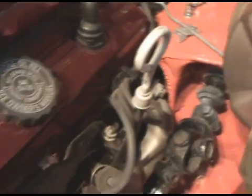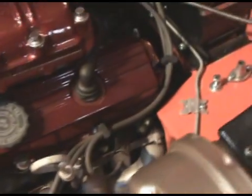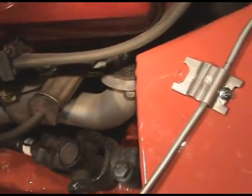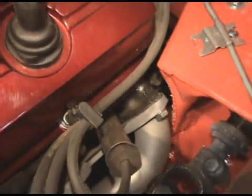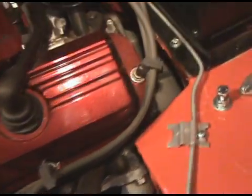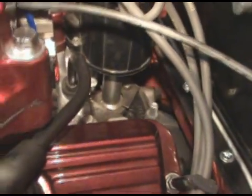The cutout they tell you you need for the manifold — no problem with the steering knuckle clearance, and that's not an issue even though I bought a little one. But the way they tell you to cut that out, I should have cut it back, not just divot it. Didn't need to dent the firewall; it would have cleared the top.